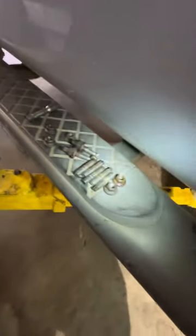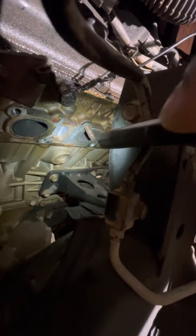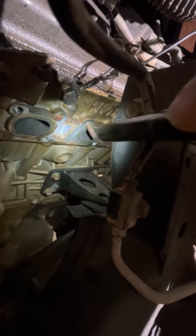So what I did was remove all the studs, as you can see. I got all the studs taken out except one to help me guide it back in. I left one stud — the second to the rear — on top. That one can stay in and it will still come out. You can leave that in there at least to help you guide and hold it while you're trying to start up the rest of the studs, because without it it's going to be difficult to hold it in there — it's a tight space.